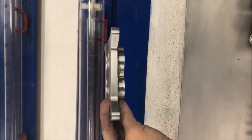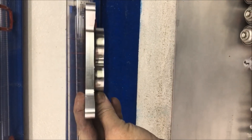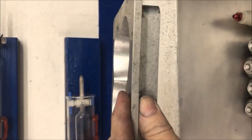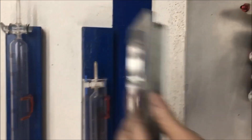Anything that extends into the plenum — you see how long that is? Anything longer than a half inch is not a good idea. You don't want to ever put this stuff down into the plenum because it will mess up the fuel curve more than anything. This plate actually sits down into the plenum area — it's got a little shelf there, so only a quarter of an inch is actually sticking up above the plenum.